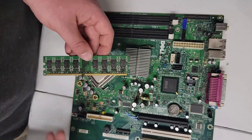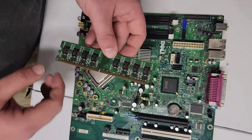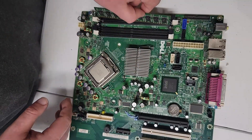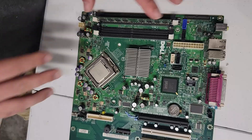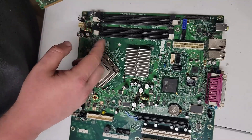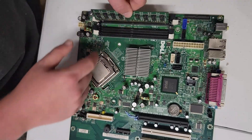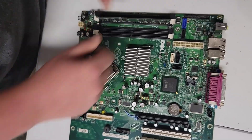After you open a program, your CPU will say to your RAM, 'Hey, I need you to store this so we can run this program and open it quickly.' On average in a standard computer, you're going to have anywhere from 8 to 64 gigabytes of RAM. Servers can go up into the thousands of gigs. This one is just 2GB DDR2, but it all works the same. If you look at any RAM stick, it's going to have a notch that lines up with a slot on the motherboard; you push it down and the tabs on each side lock into place.